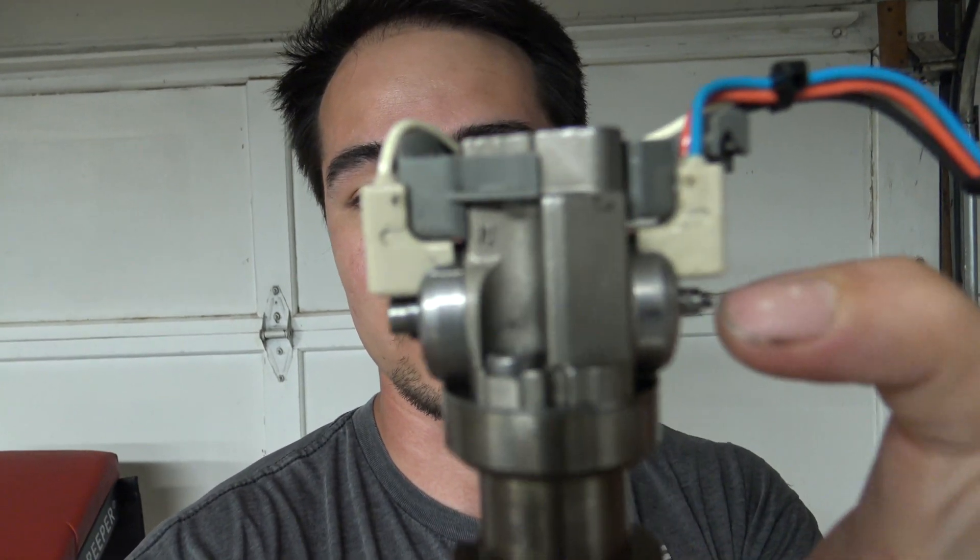I hope this breakdown guide tutorial helped you out. I've definitely been doing a lot of research on the 6-liter injector — I had misfire issues after I tried to sand my spool valves. So definitely pay attention to the torque on that bolt. It's not there to hold the spool valve in — it's just there to hold the coils on. You don't want to over-torque it and flex those coils, because you'll have a misfire you'll be chasing for days. The 6-liter truck isn't as bad as they say it is if you maintain it properly and do your research. Thanks for watching.